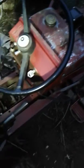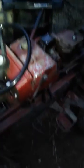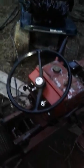It's an 876 Wheel Horse, supposed to be a '67 model — correction, '66 model. Outside of that, I'll almost fire it up and show you how it smokes. Like I said, it runs perfect at idle, and at low, medium, and high idle, but when you put it in drive it might go as far as from here to the riding line over there.